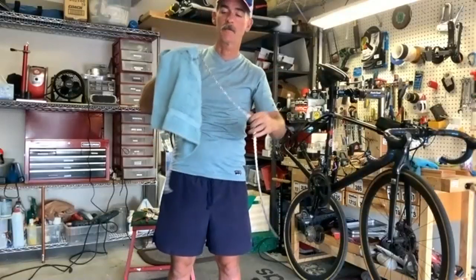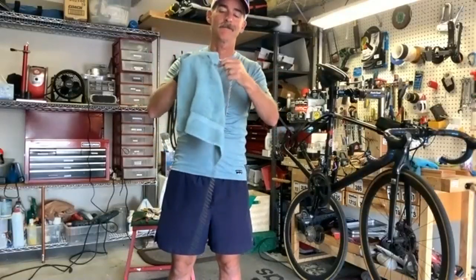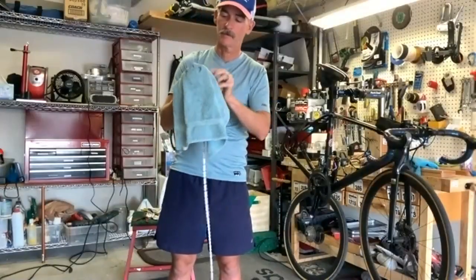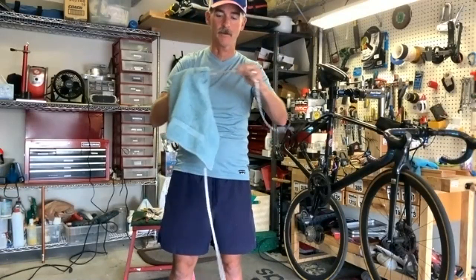Now, your quick link, are you going to use a brand new one? I am going to use a brand new one, mostly because, well, you don't have to, but that one is actually a little old. I know bike shops will say you can't reuse them, but I reuse them all the time. That one's probably 4 or 5 years old, so I got a new one.